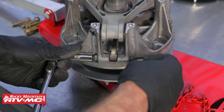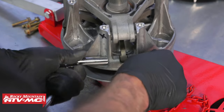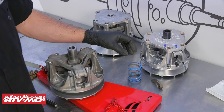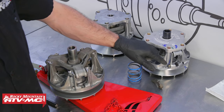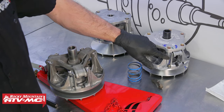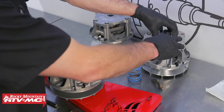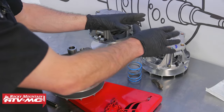At this point, remove the bolt going all the way through. If the spring and weights check out okay, install them onto your new clutch. As this goes back together, torque all the fasteners to spec and make sure the cover is indexed with the tower — get it back in the same orientation it came off. If you're not using the clutch compression tool, make sure once you get a couple of bolts started, tighten all of them down evenly in a few different steps to keep everything centered.